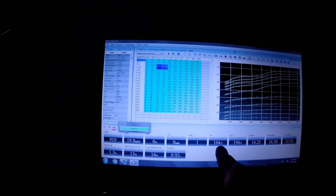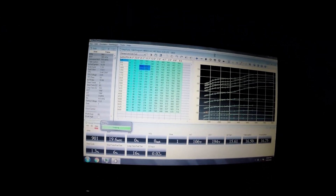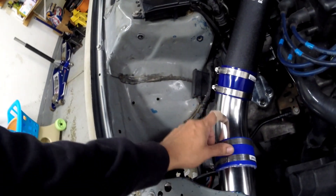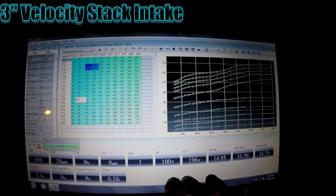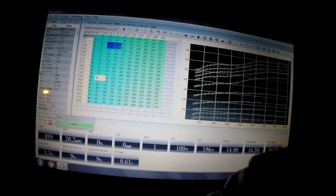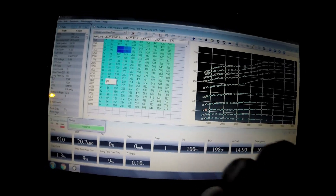Temperatures were able to go down to mid-90s to high-90s, so it's not bad for steady cruising - almost like a 10 degree difference. Now there's a three inch intake setup mocked up and testing it out. The intake air temperature for the three inch intake pipe with the velocity stack - at idle it's sitting around 100 degrees Fahrenheit. At cruising speeds it was sitting around 85-90, and once I picked up some speed around 50-55 miles an hour it drew more air into the velocity stack and dropped temperatures down to 78-80 degrees. The higher the speed, the more air you draw in straight into the velocity stack.